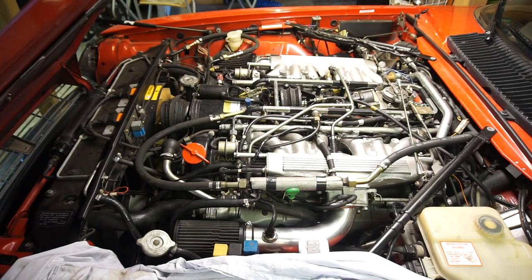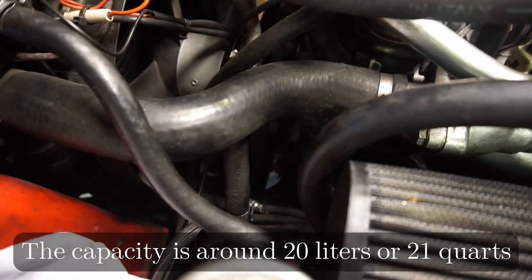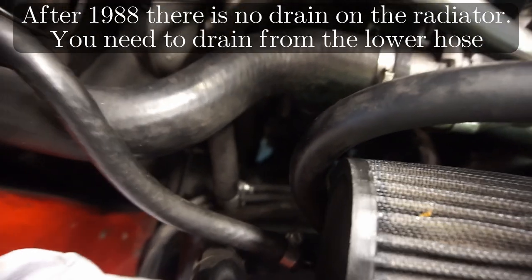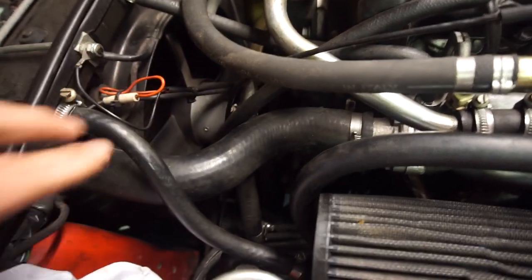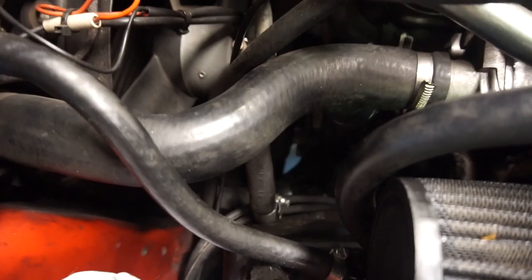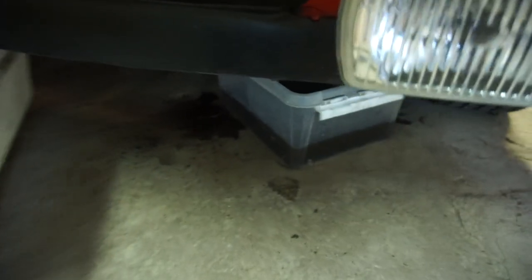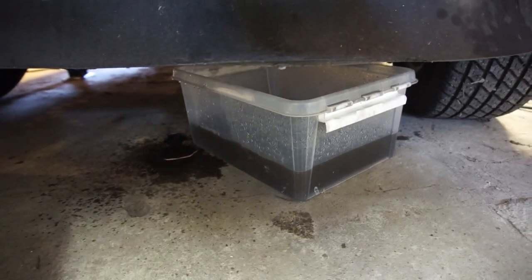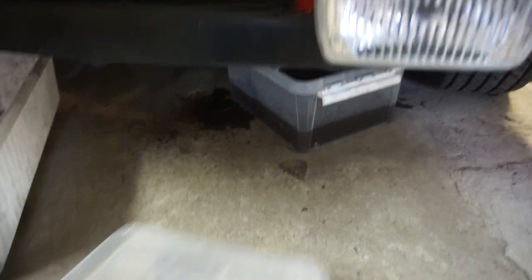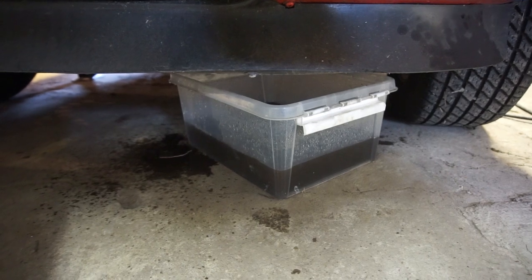As you can probably hear, the first step is of course to drain the coolant system. I did the same thing I did with my XJ6 — I cut the lower radiator hose. The lower radiator hose is that black thing you can see all the way down there. I made an incision in there and put a screwdriver in the hole just to open it up a bit, and now it's draining at a reasonable level, probably not making too big of a mess. It's draining into a container down here. That container is big enough to hold the whole coolant system in one of these cars, and the great thing about using one of those containers is it has a lid — you can safely move it to the side and leave it in your workshop without having an open container of coolant.